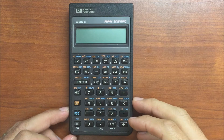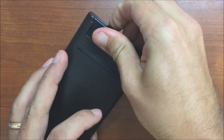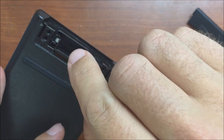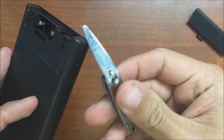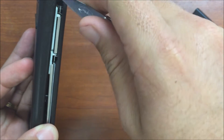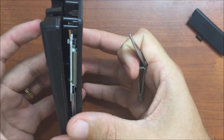I'm attempting to do some repairs on this HP 32 S2. I pulled it apart — if you pull off the battery cover there are four rivets here. I've already popped these ones; it takes a little pressure, those four rivets go down a little bit and then pop out. I used just a pair of fingernail clippers and ran it along the edge, careful not to get into the PCB, to separate the keyboard along just the very edge and got it open.